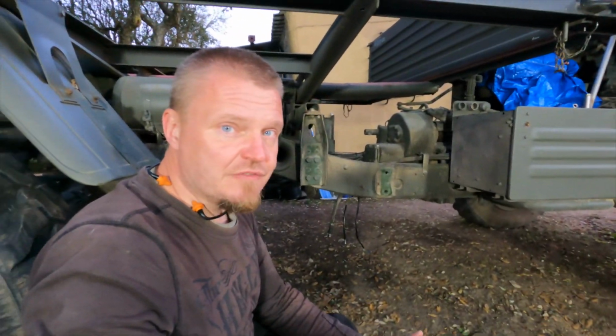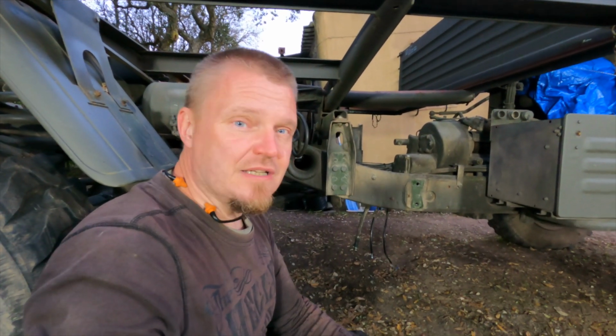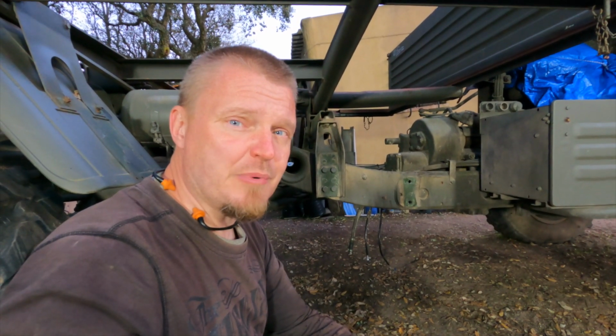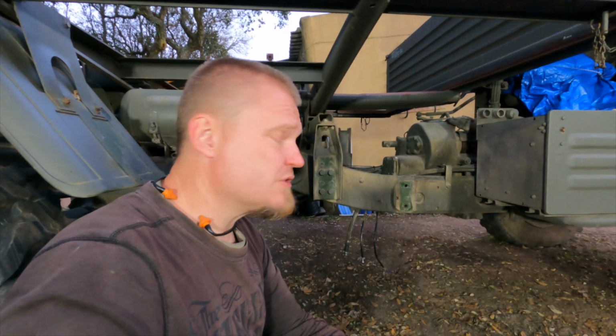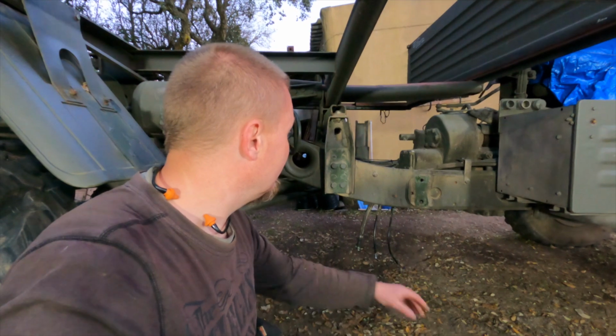The tank itself is in quite good condition. I can't see any rust on the inside. The brackets and the straps are quite okay too. The straps have a little bit of rust on them. I buzzed them quickly with the flap disc and a wire brush thingy, and gave them a bit of zinc primer, so that hopefully they'll stay okay-ish for now.